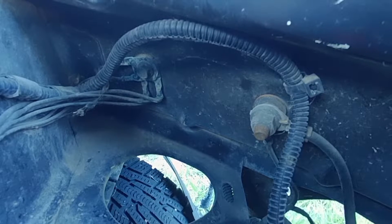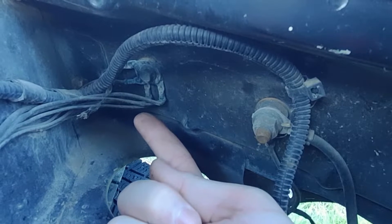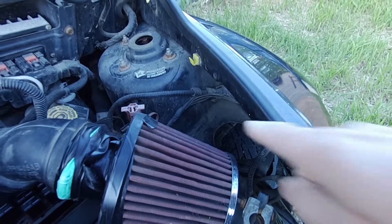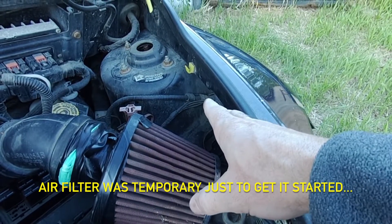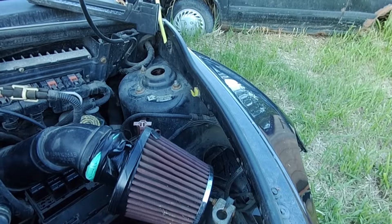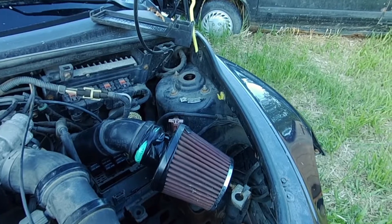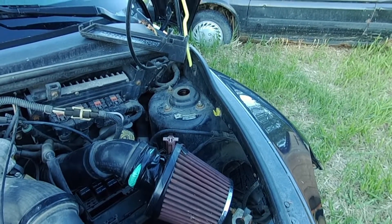Here's the initial start of your cooling system right here — these are the main grounding points on the car, located right down here by the battery and the air box. The reason I say that's the start of your cooling system is because your cooling system on a PT Cruiser is largely electronically based, and as such the ground points are vital to its proper performance.